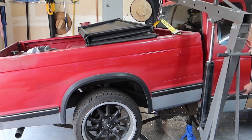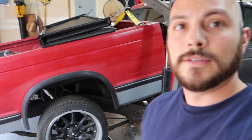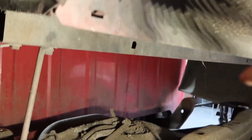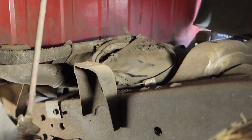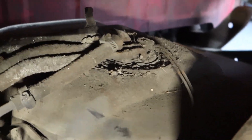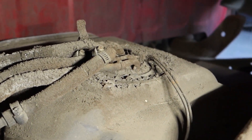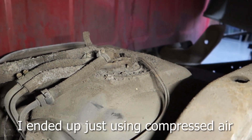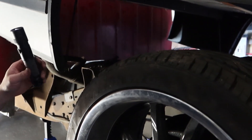Now I'm going to look around and make sure nothing is pulling. We got it somewhat tilted - walk around to see how close we are. Bed's up and there's our fuel pump. There's quite a bit of room. I'm going to try and see if I can repair it from here. It's pretty crusty, so maybe some brake cleaner, or just try and get it with a towel first and then brake clean it.